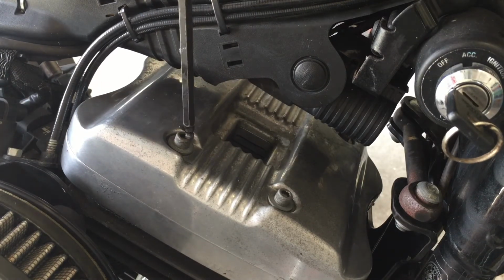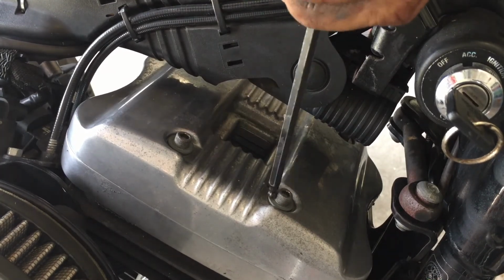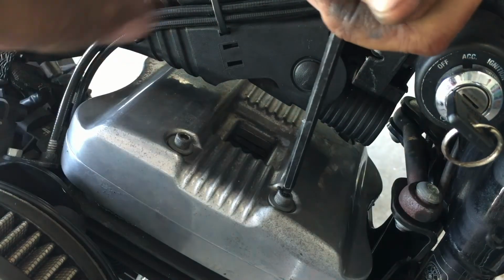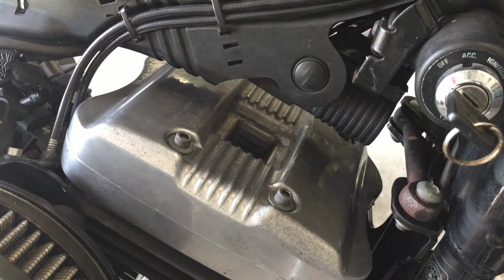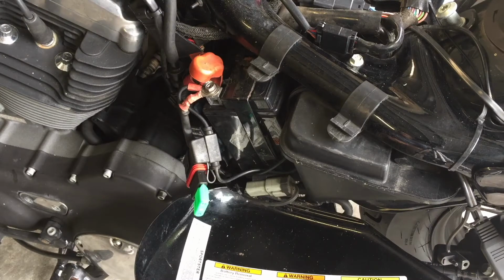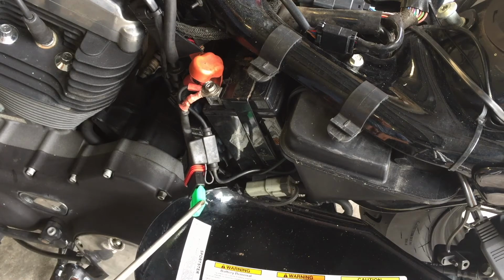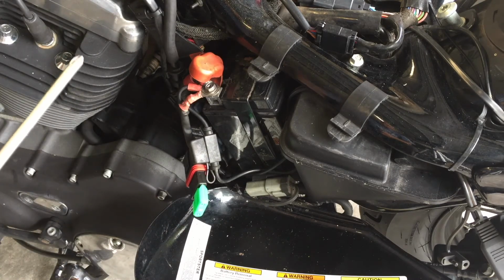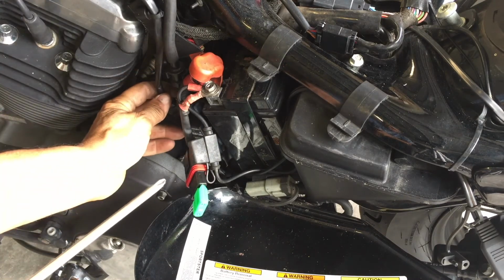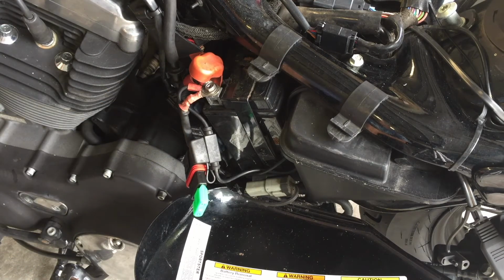Corner to corner. Don't go crazy, you'll break these. There's no need for it. We put that little bit of Ultra up there. She'll seal and never leak again. I'm gonna put it back together and then start it. All right, with that, I got the 15 amp in place. I got the 30 amp back. I got the tank on. Tank is hooked up to power. That's your fuel pump. Everything nice, lined up just the way it was.